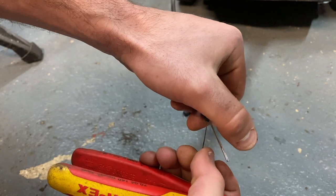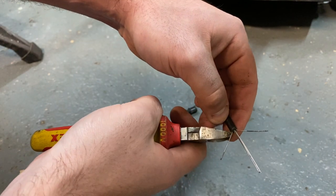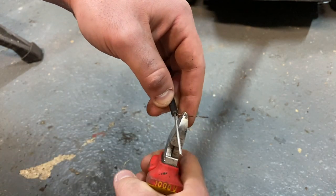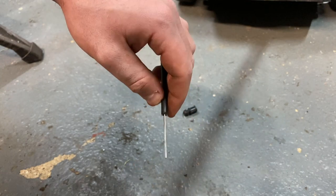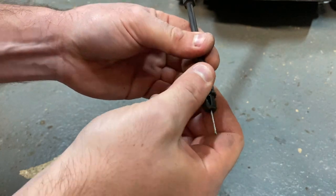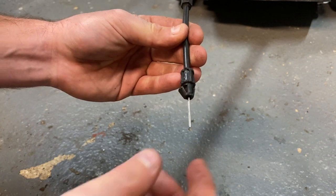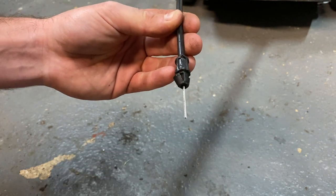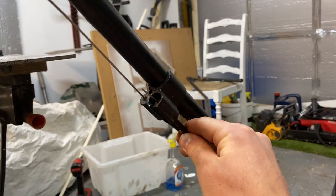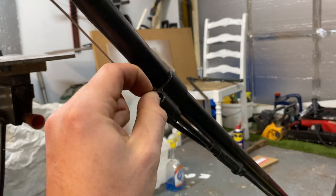As you can see it's got these little steel reinforcements here — just trim those back down to there and put that over the end. So we've got a nice little bit here to work with, and we've shortened this section. It sits in there, it's all clipped in, and we've just got enough here so we can crimp on a new piece of wire.